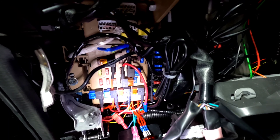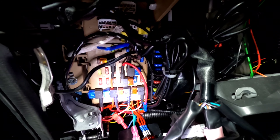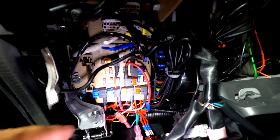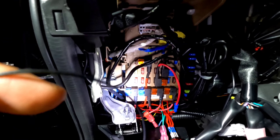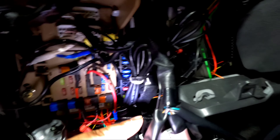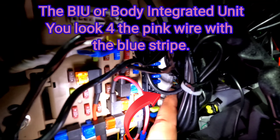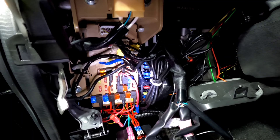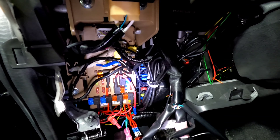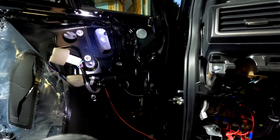So in essence, what Subi Speed did was they ran the power wire — the red wire — onto their adder fuse and tapped in there. The black wire goes to the Body Integrated Unit, the BIU. There is a wire in there that we tap the negative wire into. What that does is that wire does have power to it, so when that power fades there is no more ground — that's how they got the lights to work.